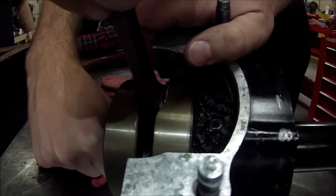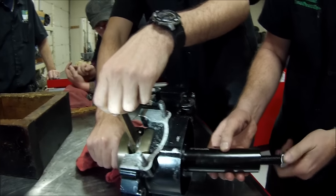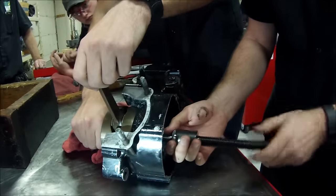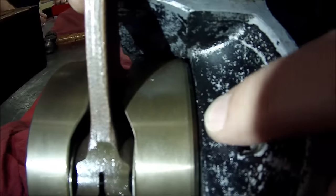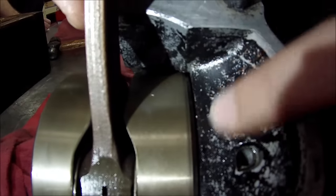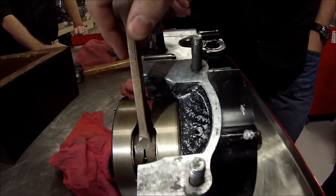You can see I turned the crankshaft — that's all we need to do. Go ahead and disassemble the tool. We'll check our work. I want to make a couple pointers here. I am in love with this tool — this is easier than mine. Thank you guys for finding this. The one thing we're going to look at is this gap in here. When we disassembled the motor, we took feeler gauges and measured that. On assembly, we just want the gaps to be even. We're sucked all the way against the bearing and ready to continue with the rest of the motor install. Way cool tool.